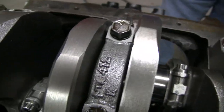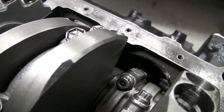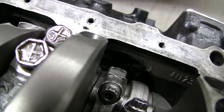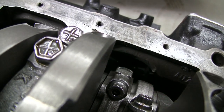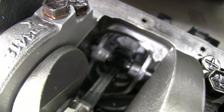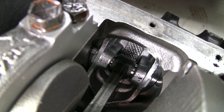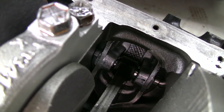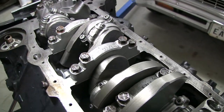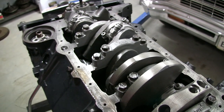Look over here on this other side right here - you can see some more of the same. Some more grinding right here in the same areas. There's a better shot right here. Just a small section. Very little. Most 383s that I've seen have had an awful lot of grinding done on them, so I just don't trust the guy's work. We're going to pull out the big feeler gauges and rotate this around over and over, check every rod, check every piston, make sure we've got plenty of clearance all the way around before we go any further. Alright, check back with you in a little bit.